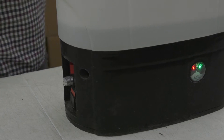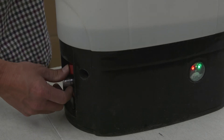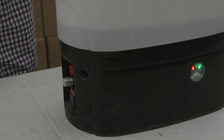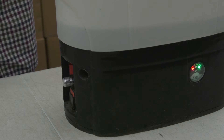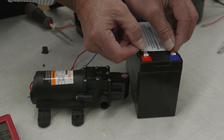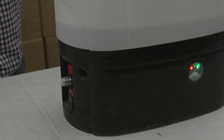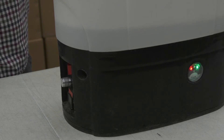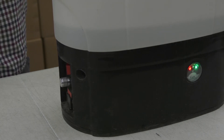The number three reason why you get no pump sound with voltmeter lights on is because the pump has failed. This happens the least frequently of all failure modes, but there is a sure way to test it — touch the plus and minus wires of the pump to your battery. If the pump spins, your pump's electrics are good. If it doesn't spin when you touch the bare wires to the battery terminals, then your pump is not working and it's time to replace it.